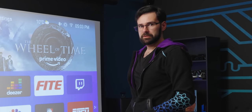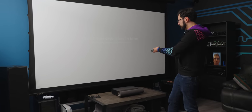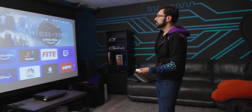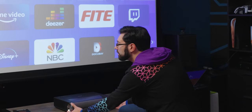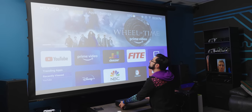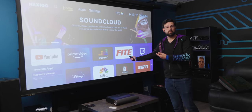One of the difficult things about a short throw projector is the throw height needs to be precise — the height of the bottom of the image is directly dictated by how high the projector is off the ground. We have a rolling screen, so we can bring that up a bit and pull the projector back until it fits. The more you can adjust the projector physically rather than in software, the better image you'll get.